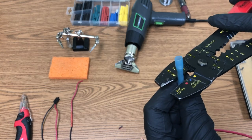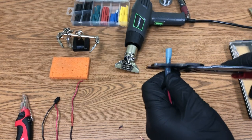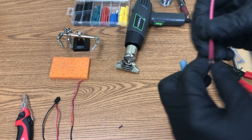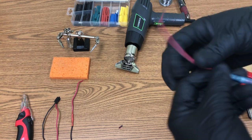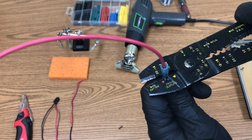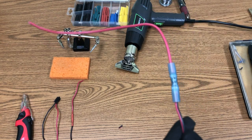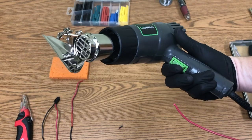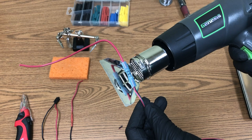Put the connector on and match it up. My wire is a touch thin — going into the 16 to 14 gauge connector — so the wire gauge is slightly off. The really nice thing about these is you can actually see where you're supposed to crimp, unlike standard butt connectors. You also don't have to remember to add separate heat shrink wrap, which I've forgotten many times. These are about two to three times the cost, but they work better.